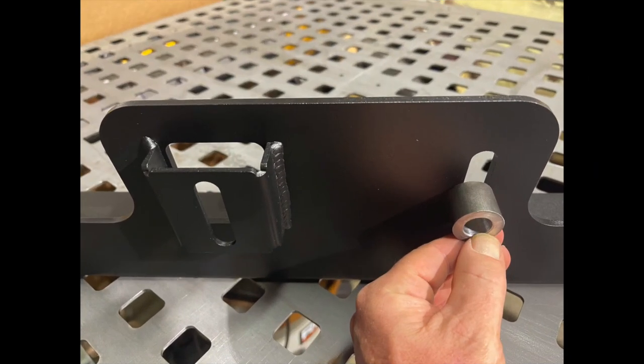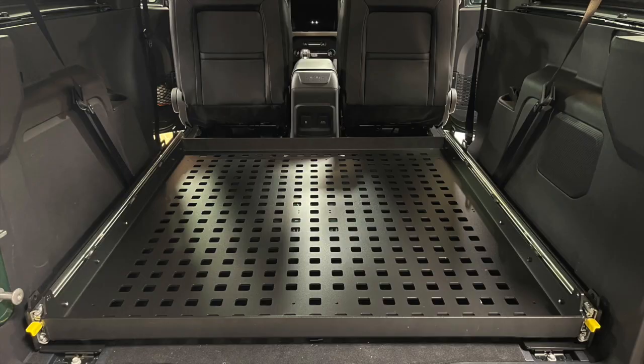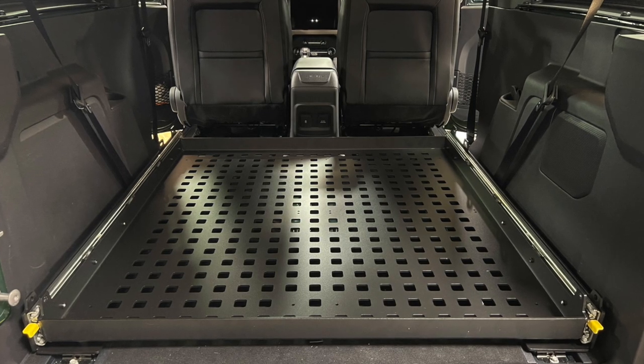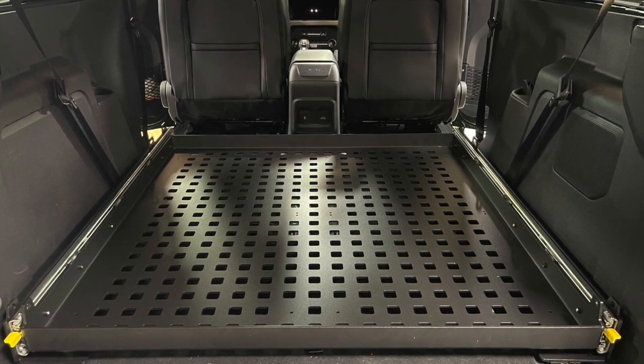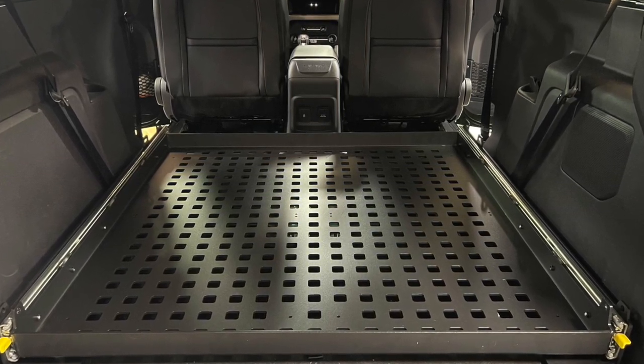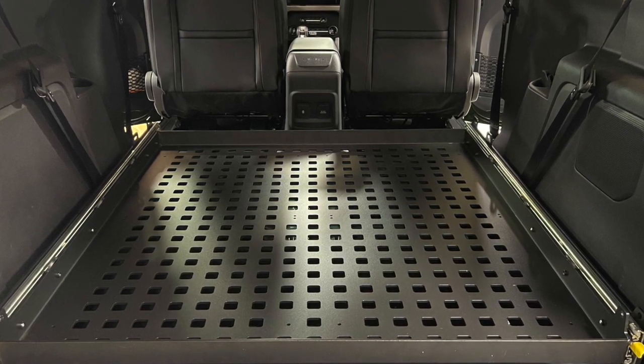The current screen shows the orientation of the spacer underneath the main mount brackets. Now to install the actual Packhorse assembly. It will take 2 people to safely install the unit. Carefully lift and place the entire Packhorse assembly into your cargo area, utilizing the studs on either side of the cargo space to correctly align your Packhorse.